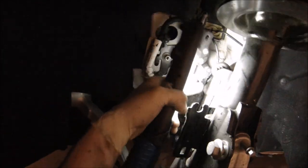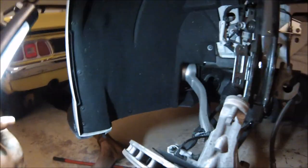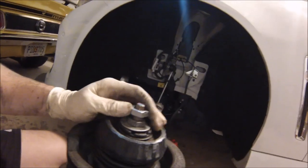Here's another tip on the sway bar end link: where it sits is a lot higher than where the shock is when you're in full droop. So I got my jack and jacked it up to be able to get the sway bar end link out. I usually like taking the sway bar end link out before I drop the spindle so we don't have any crazy binding. I got the spindle bolts loose, so let's go ahead and drop the spindle. Best way is to beat the bolts out with a dead blow so it's softer — don't use a hard pin hammer or you risk messing up the threads. So now we got the shock loose, nothing attached. I'm going to disconnect that top bolt and hopefully this thing drops out.